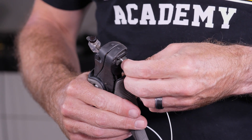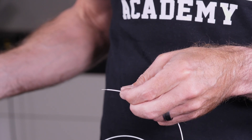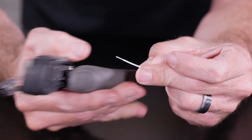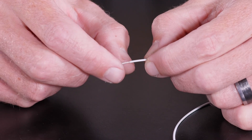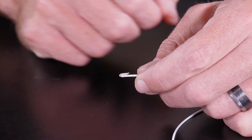The process starts by stripping the insulation from our Tefzel wire. We're using a pair of Ideal Ergo Elite strippers with a backstop, and this makes it super easy to get nice consistent strip lengths. Next we're going to bend the wire back on itself. We're doing this because the next step is to tin the conductors with solder, and that will tend to wick up the wire.